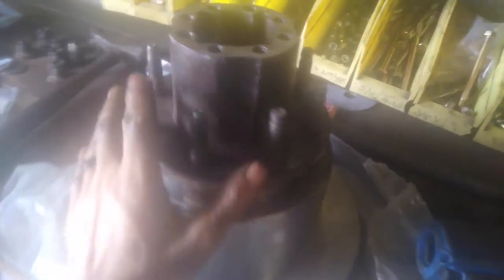You can see the washers come off with no problem. Check that all the studs are flush — look at all of them and make sure none are higher than the others. You can check by this shoulder. You really want them all level; an uneven stud can cause big problems with your wheel.